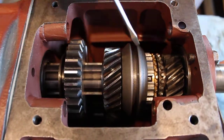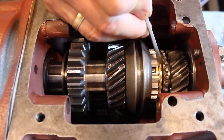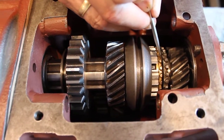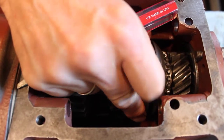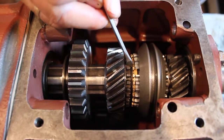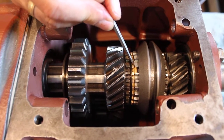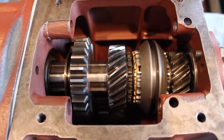Now with the gear connected as such, I've got rotational movement on the front blocking ring and slight fore and aft movement here. And with the other gear engaged and detached from the cone, I get rotational movement and a slight fore and aft play in that.